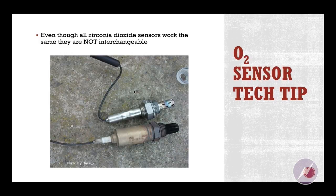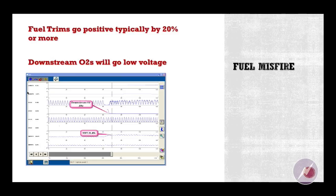The exception is if you've got a TSB or the manufacturer has specified that a different-looking sensor is the correct replacement. Otherwise, I want something that looks the same, unless I have documentation that it's an improved model and will work. The reason is that those flutes and holes are designed to catch the exhaust as it goes by, depending on the direction of the exhaust and where the sensor is in the exhaust pipe.